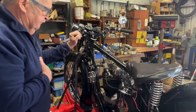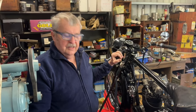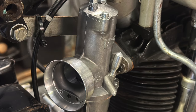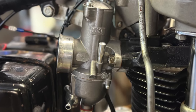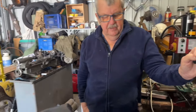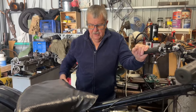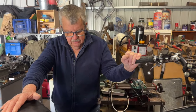Back to the engine — I found quite a few little things wrong. The cams weren't pressed into the cam wheel in the correct position, which I've rectified. It had some very dodgy tappet adjusters, so I've replaced those. I've fitted a new Mark 1 concentric Amal carburettor — a 30mm one — with a number 3 slide and 280 main jet, which is a really good starting point for these bikes. I haven't even put the fuel tank back on it, but I tipped a bit of fuel down the carb, gave it a kick, and away it went. Originally the magneto wasn't sparking, but the owner sent the Maggie off and got it reconditioned — and it seems to be quite a good job.